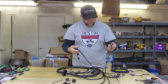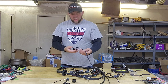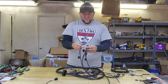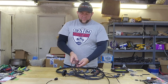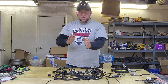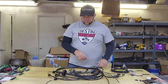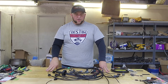Lastly, you'll have your fuel injector wires — they'll just hook up to your fuel injectors. These are also color matched to the ignition coil connectors: white for cylinder six, purple for cylinder five, and yellow for cylinder four. So they're all color coded, and they all color match — that's a quick check to make sure you have the right ones hooked to the right place, because cylinders five and six on the ignition coils can actually reach the other ones. That's a fair rundown on the harness and how to hook it up.